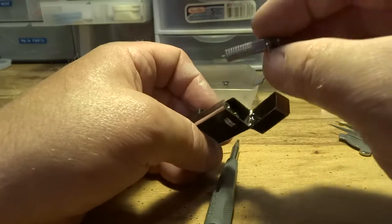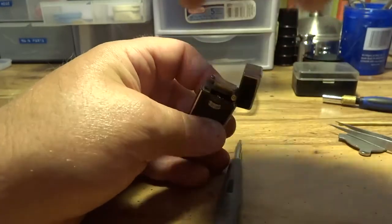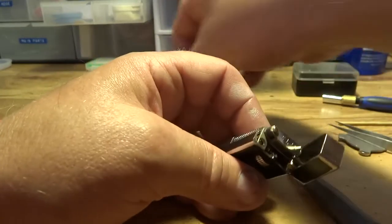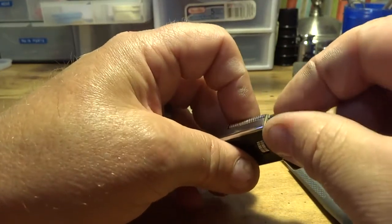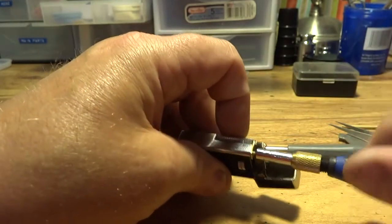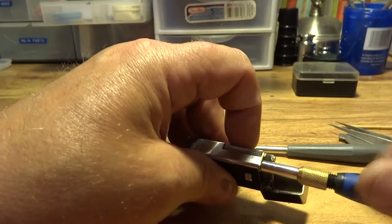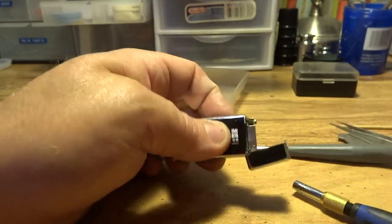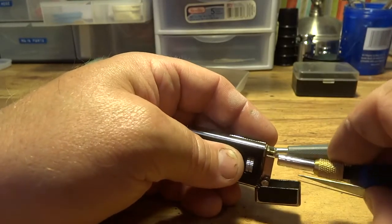So what we want to do now is put the lighter back together. You're just going to stick that in there and find your hole. What holds this basically on this plate right here is your burner valve, this pipe valve. You put that on there and screw that down. Now I put O-rings on this because I don't have washers, and when I tightened that down to where it was tight before, the opening for the pipe valve was behind here instead of out the front. So you can see right here it's pointing at you. I'm just going to turn this a little bit more.